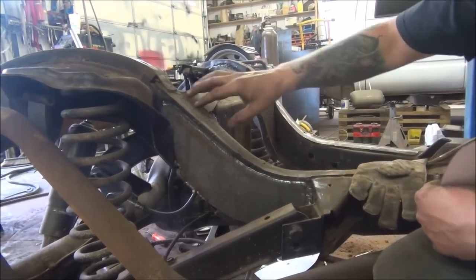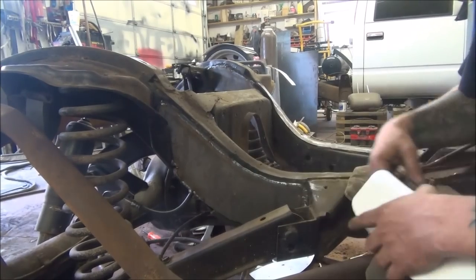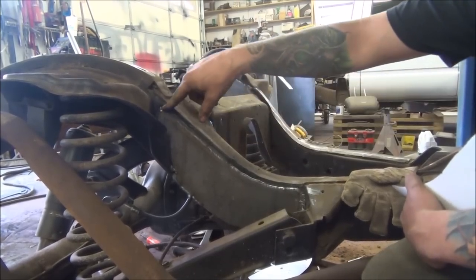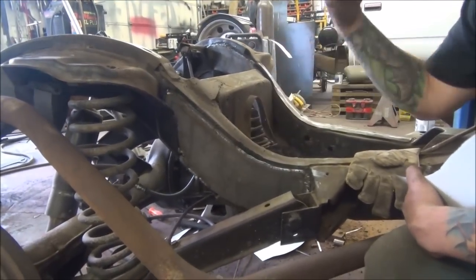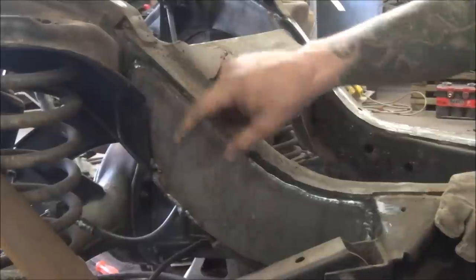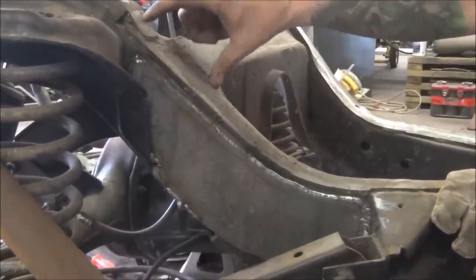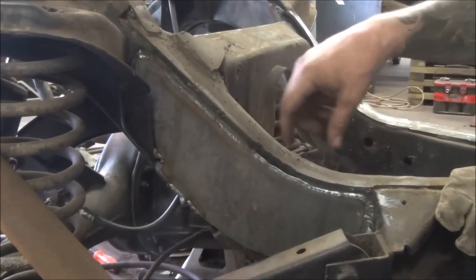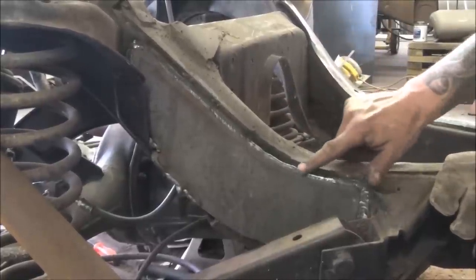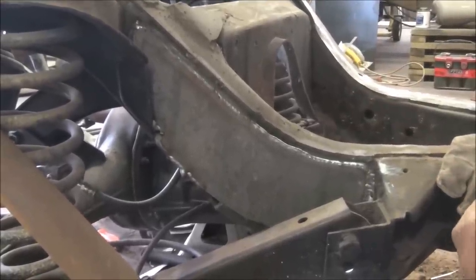Here is a section of the frame just before the rear spring perch where we got a piece of 3/16" welded in after cutting it from our template. One of the things to note is that when you've got the C-clamps and it's clamped into place, you're not just welding the entire thing all at once — that's going to get the metal hot, make it warp. What you do is tack it in three or four spots to hold it, then weld three or four inches at a time, not all in a straight line. Do four inches here, four inches on the bottom, four inches there, and eventually they'll all connect — but you're not keeping the whole thing super hot. Once you're done, if you've got beautiful welds, you're good to go. If you've got rough spots, come back through, take your grinder, and get rid of those rough edges.